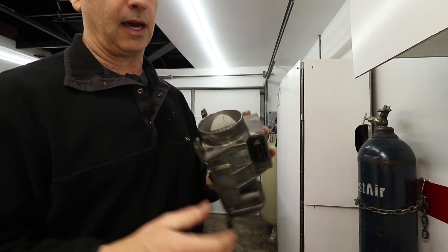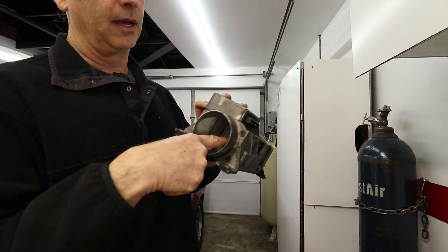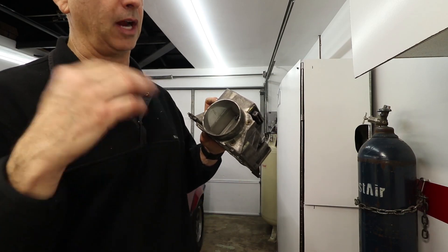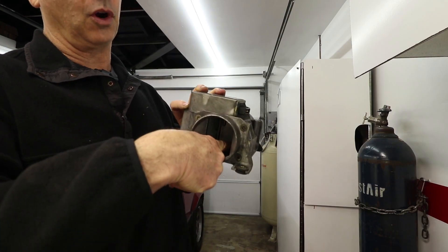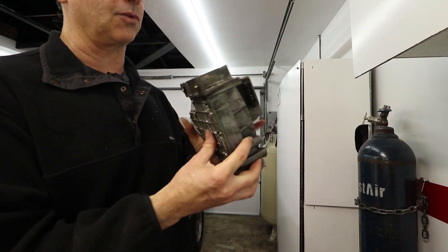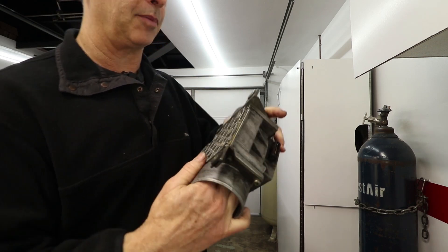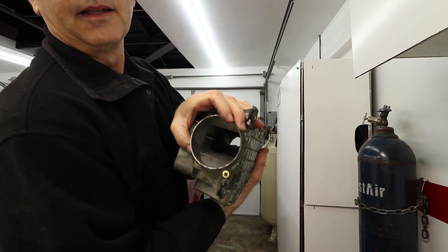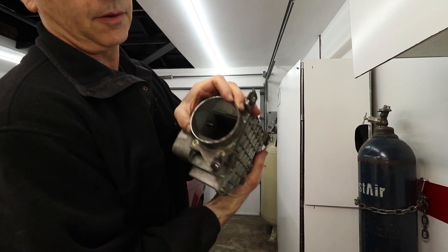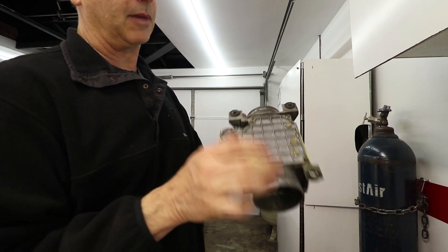The way this thing works is basically a barn door. It's a mechanical meter that measures how much airflow is going into the engine. The more flow that goes in, the bigger this door opens up. It also measures things like intake temperature. That would be like full throttle, and it just outputs a signal based on how much the door is open.